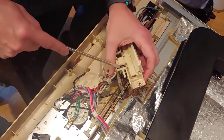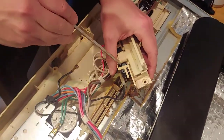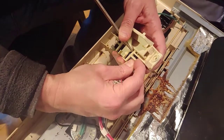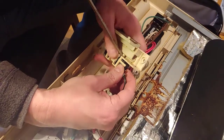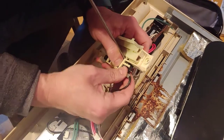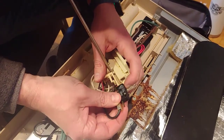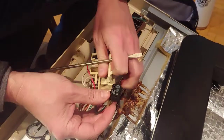Let me show you how these micro switches come out. You see this hook right here — you want to gently pry that out of the way. The micro switch itself can get hung up when depressing, so you want to take something and put it under there while you use the hook to extract it. You need about four hands to work on this. See that little micro switch — that's what actually pushes the button, and that's what's getting hung.